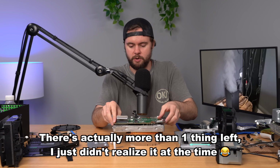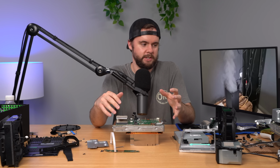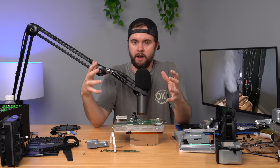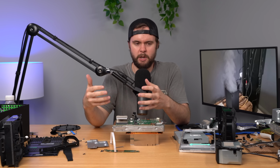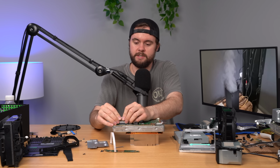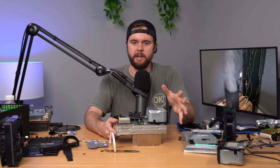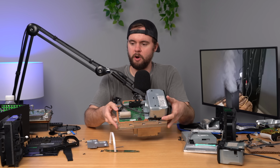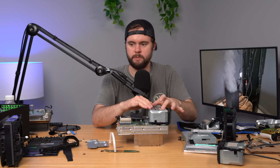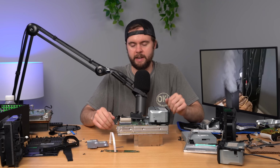There's one other thing I want to try, and this is not going to fix our Xbox, but it's going to be interesting. We want to see if the original power supply on the bad Xbox is bad or not, because that was the original thought, that it smelled, it didn't turn on. We thought that was a bad power supply. So I'm curious if that is still a bad power supply. So let's go ahead and try that out. Basically what I'm doing here to test this is I have the original cardboard Xbox Series X and all its components, and then all I did was swap out the power supply to the bad, or supposedly bad, power supply, and we're going to plug it in now and see if it works.